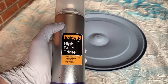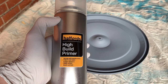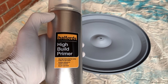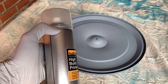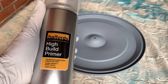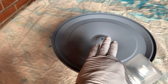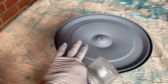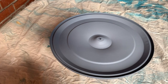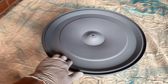I'll be using an etch primer, high build primer and then black satin. The etch primer bonds to the surface well and creates a strong foundation. The high build will then fill in any tiny gaps and imperfections in the surface and can be sanded down to a smooth finish. If this was a body panel it would be a very long process involving a guide coat as well — if you're interested in learning more I'd recommend checking out an excellent Eastwood video linked in the description.